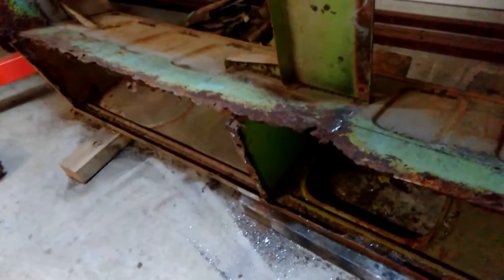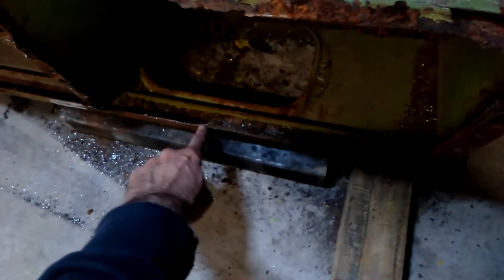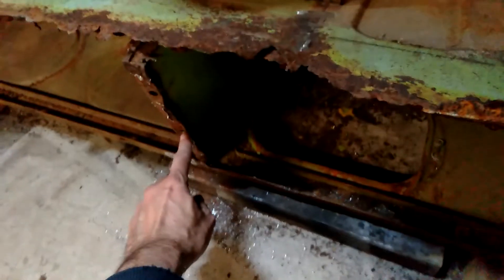It's been a day or two since I last reported anything, but I'll show you the progress so far. On the left hand side, left side pannier, removing the floor panel - there it is there. I've managed to drill out the spot welds from the rail. This bit needs to be fixed up - I made one hole over there but that's not an issue. I'm thinking I might just cut that whole piece out as it's very hard to get the spot welds out. It's a bit rusted on the other side too, so it may just be better to replace that whole corner piece.